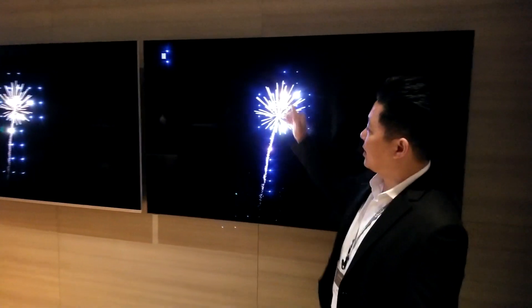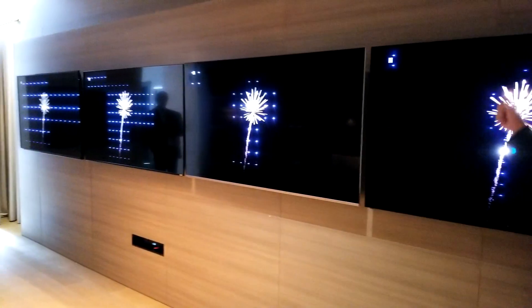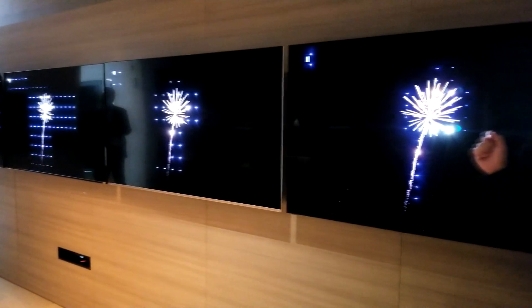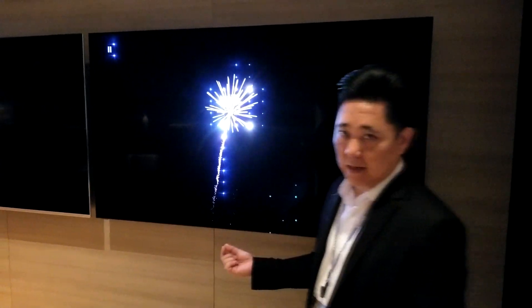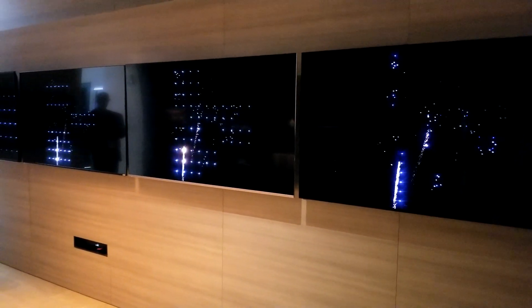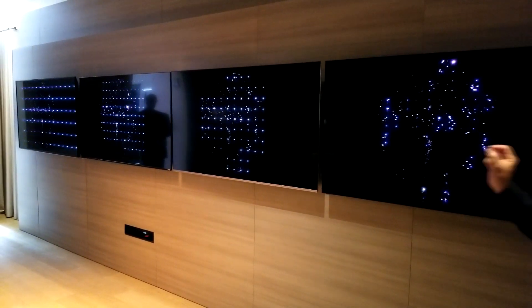We can get more aggressive than M series and E series. In P Series Quantum, we actually have 192 zones — 24 columns and 8 rows. As you can see, it's much, much tighter. It's not like OLED pixel-for-pixel, but much tighter as far as the content and the zones allocated. So we can go more aggressive here than in P, M, and E series as far as dimming and peaking. As you see the content running, you can really see these active LED zones in P series especially being very tightly controlled compared to the other series.